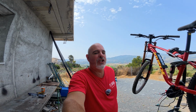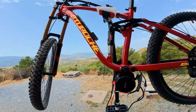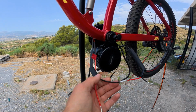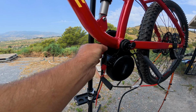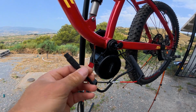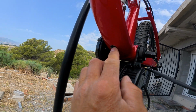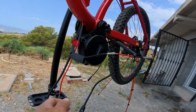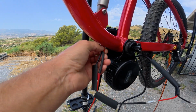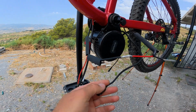So just let me turn you around and show you. Now, if you recall, we pulled these cables through to solder with the intention of pushing them back then through here and then putting this motor connector back through. But this hole, by about 1 millimetre, is only just big enough to get this connector through. So obviously with the thickness of these battery cables, if we do them first, we're not going to be able to get this connector through afterwards.